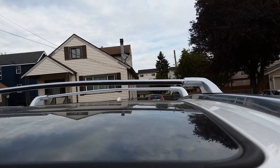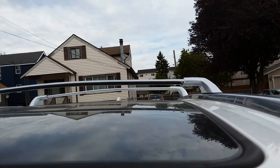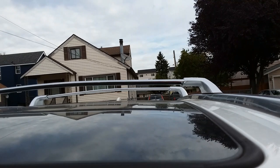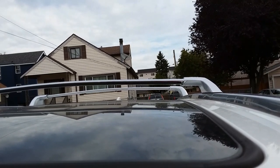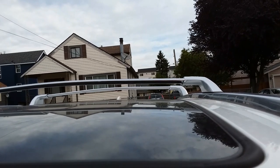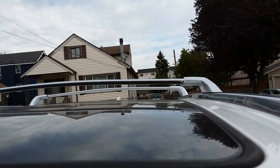So what are the benefits of having a higher-rated crossbar? When I look at the Thule website, it states that if you want to put a roof-mounted tent on top and have one or two adults sleeping on it, the stronger crossbars would help prevent them from bending or bowing. So if you're looking to put on a roof-mounted tent, that's something that would be beneficial with these thicker and stronger crossbars. I was also reading on the Thule website that the static weight is on average about three times that of the dynamic weight capacity — good information to know.